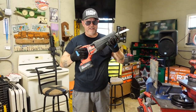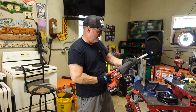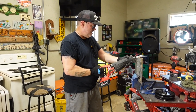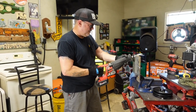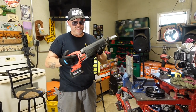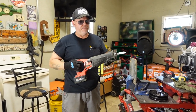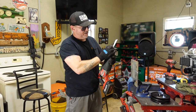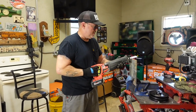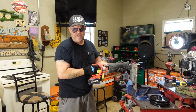Let's get to cutting. If you're wondering why I'm going in and out with a saw motion, it's because I've been using sawzalls for a long time. I learned a long time ago you can extend the life of your blades by moving them around on the work piece. If you just let it cut in one spot, you'll wear those teeth out while you still have brand new teeth further up the blade. So when possible, move it around.